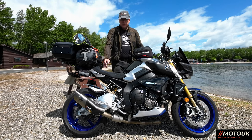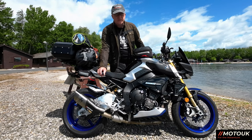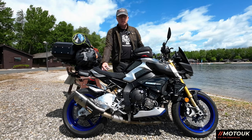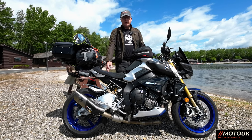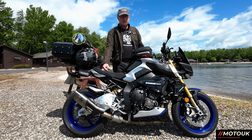The second thing I do is give it a good oil change, a full service, and do the fluids — brake fluids and coolant. I also adjust the chain, make sure it's cleaned and lubed, and double-check the brake pads have enough wear left to last the trip. Just keep on top of your bike, make sure it's tip-top and ready for a long journey.